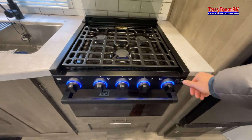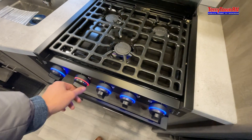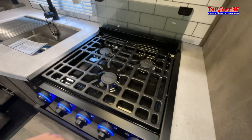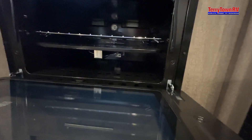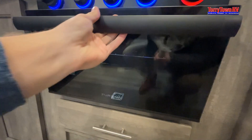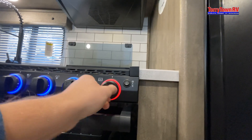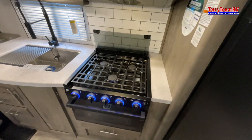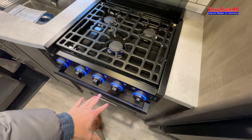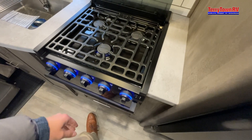Coming to your oven and stove — lights: click to turn on. Press and open up, then turn it right to spark. Same goes for all three burners — there's no gas going through it at the moment so it's not lighting. For your oven, press, turn, and hold up to the pilot symbol. You can see the tiny little igniter in the back — it'll sit there and spark and then eventually a flame will appear. Once that flame appears, go ahead and adjust your temperature to whatever you'd like. The oven is not going to light right away, just because there's no gas purged through the system yet. I recommend lighting all three burners at the same time to let the gas go through the lines, and then try the oven. It's not going to be on the first try — it'll take a little while, but eventually it'll start.